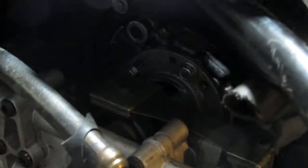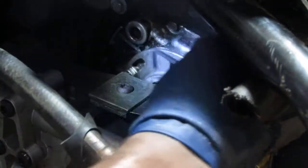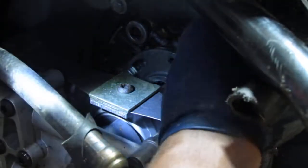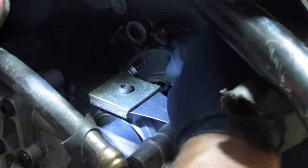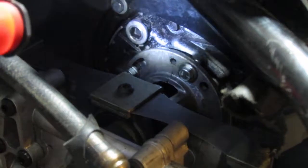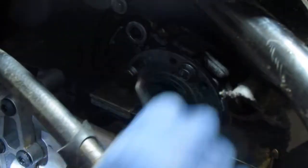I don't think I want to reset the governor to modify the idle. It's a little high. It's at 4,000 RPMs, but it can go to, it said 3,700 I think, or 3,800. This should be the high RPMs. Not too bad. If you ask me, I'm going to leave those settings alone, and then we should just test it and see if this pump actually works.